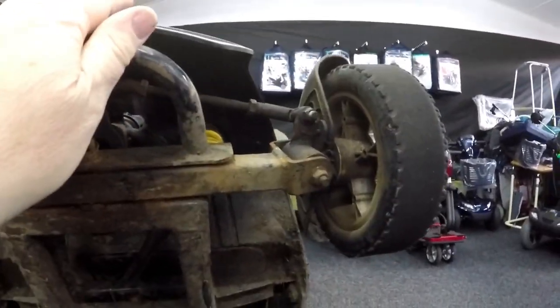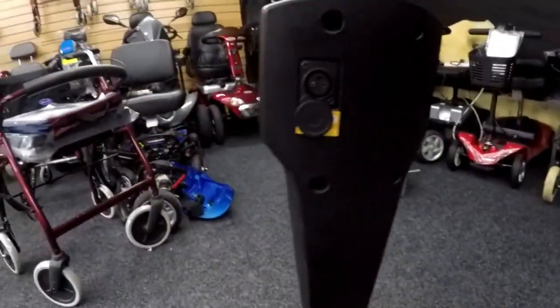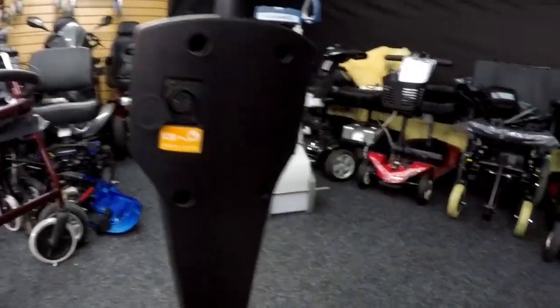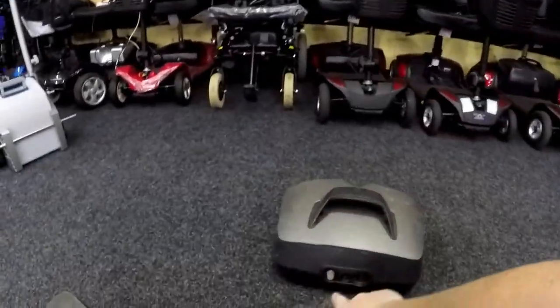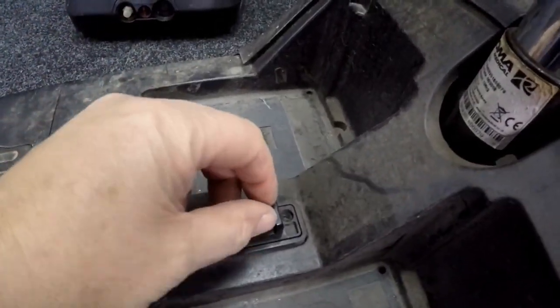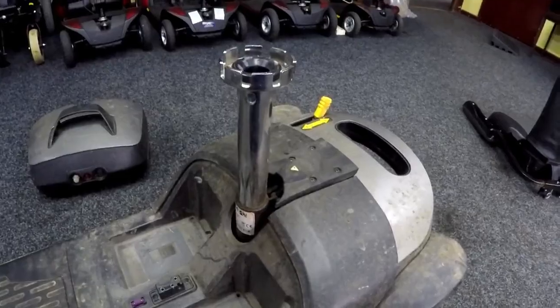The rubber is wearing off — he was offered a replacement scooter but decided he wanted this one repaired. I also noticed he's broken his charger socket — the pins are broken in there. With this scooter you can charge at the socket or charge directly on the battery, so there are two places to charge. I need to replace the charger socket as well. I've checked all the connectors on here; they look okay, a little worn but not burned. The next step is to check the connectors behind the panel.